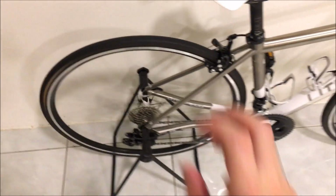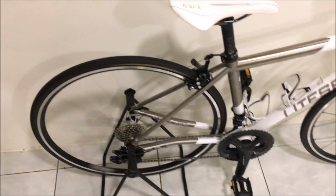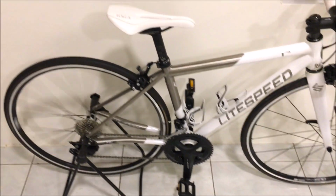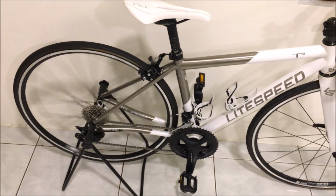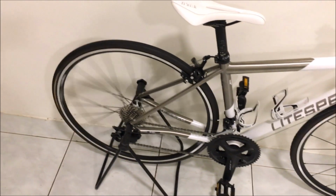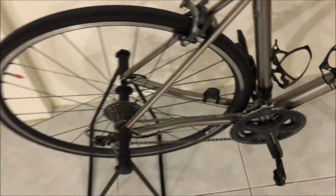It's actually the 18 tooth ratchet that DT Swiss are using, that one, and that can be upgraded. The ones in the bike that I have over there are 36 tooth, and you can actually upgrade them to 54 tooth, and the 54 one sounds a lot more aggressive. I'll spin the wheel on my bike so you can get an idea of the difference. Sorry about the junk lying around the house.